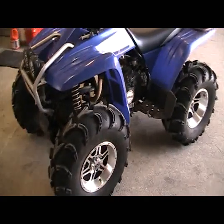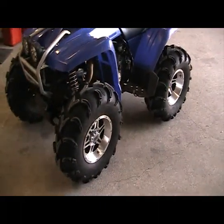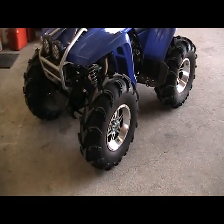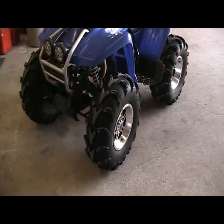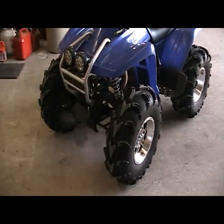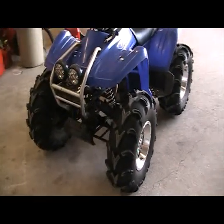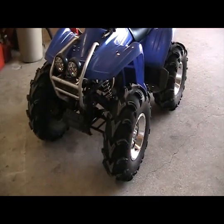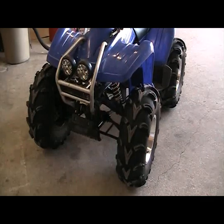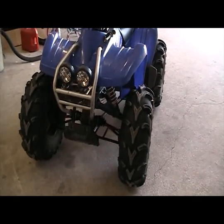What we're going to do is take this bike and pull the top end down. We're going to put a 366 big bore kit, which is a JE 85mm, 10.5 compression ratio piston. We're going to put an aftermarket cam in it. It already has a really nice aftermarket exhaust and air box.